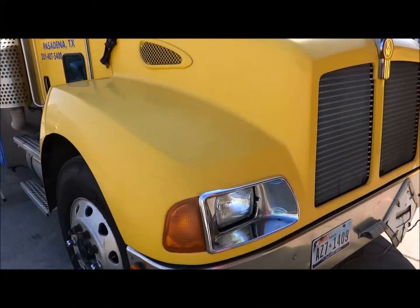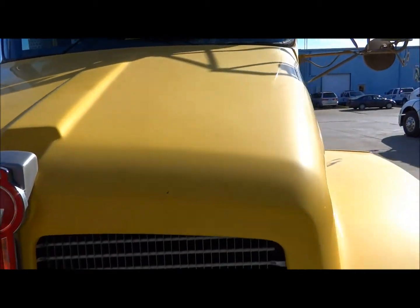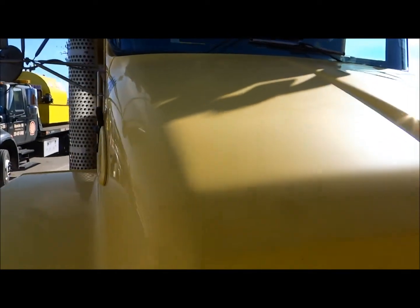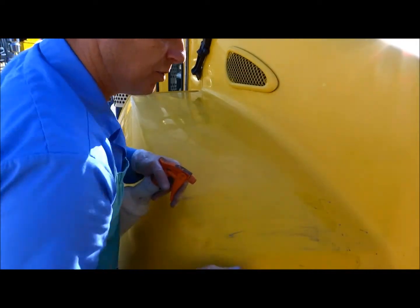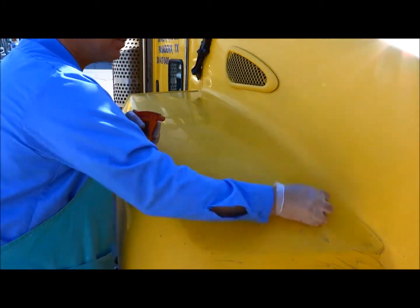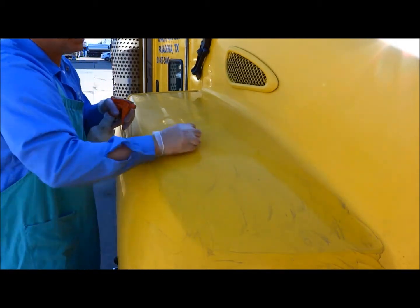We have the front of the truck. I'm gonna show you how dry that is - plus it's got overspray on it from being in and out of the plants. The paint is just from being out in the weather. So what I'm gonna do is just a little test spot on this panel. If you're polishing a vehicle and you don't clay it first, you're just polishing over grime, dirt, and iron dust from the brake system. You have to clay everything.